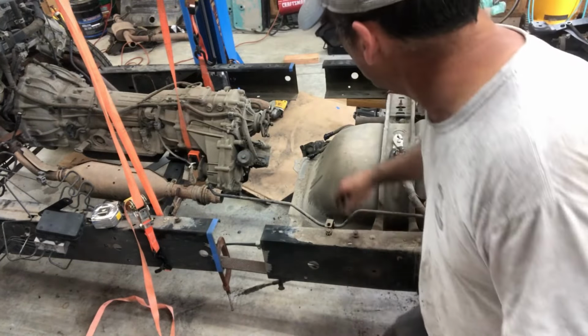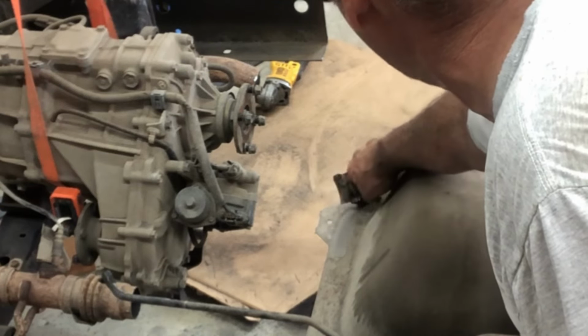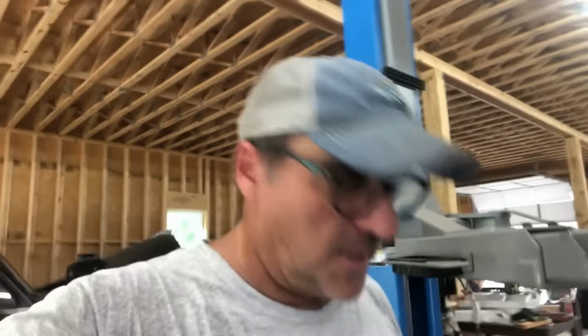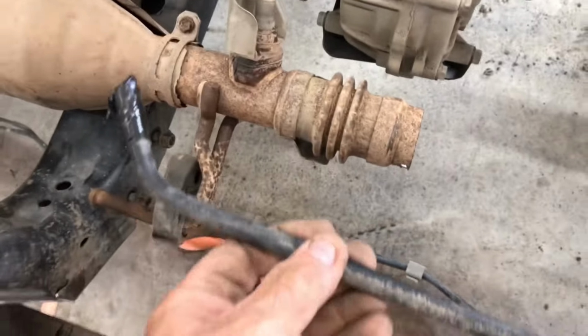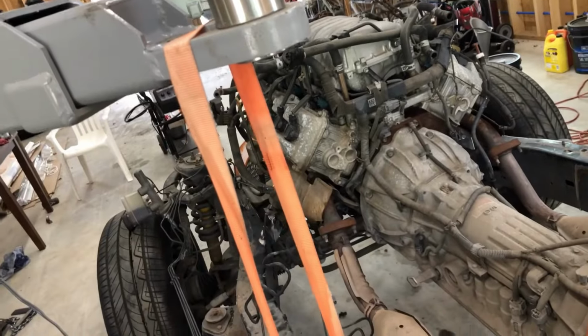Only one thing I see really is this control module is gonna get really close to this little funky spot for some reason on this gas tank. Now here's one thing you need to know before you start cutting or welding around a gas tank. These are the two fuel lines. One comes in, one goes out. I taped them up good. But there's also one other thing. This line right here, this plastic, you wouldn't think nothing of it. There's no fuel drips out, but this line actually comes over and goes to your evap tank. All your fumes in your gas tank run through this, it cleans them, then they go through this line all the way around, all the way up to your intake, and it sucks them back in, feeds them through the motor. The thing is, it's not gas that's explosive, it's the fumes.